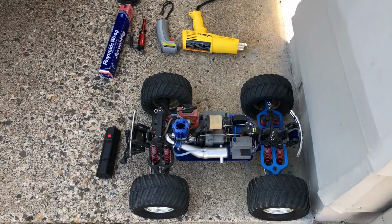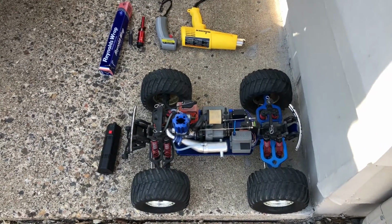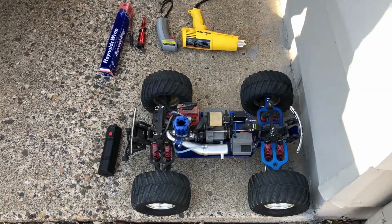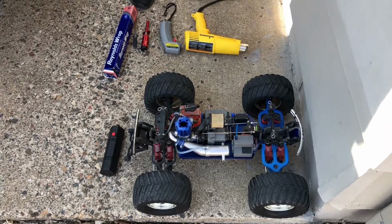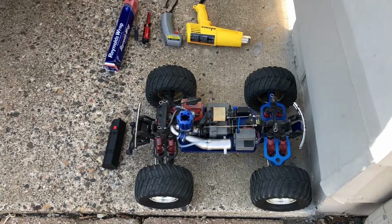I'm going to be doing the Adam Drake method, the same method I did with my SH18 engine in a previous video. Four tanks of idling and then quarter throttle accelerations and so on for the next four tanks. So eight tanks in a break-in. I'm going to be starting off by heating the head up to about 200, 210 degrees, wrapping it with tin foil, and then we'll do the first start.